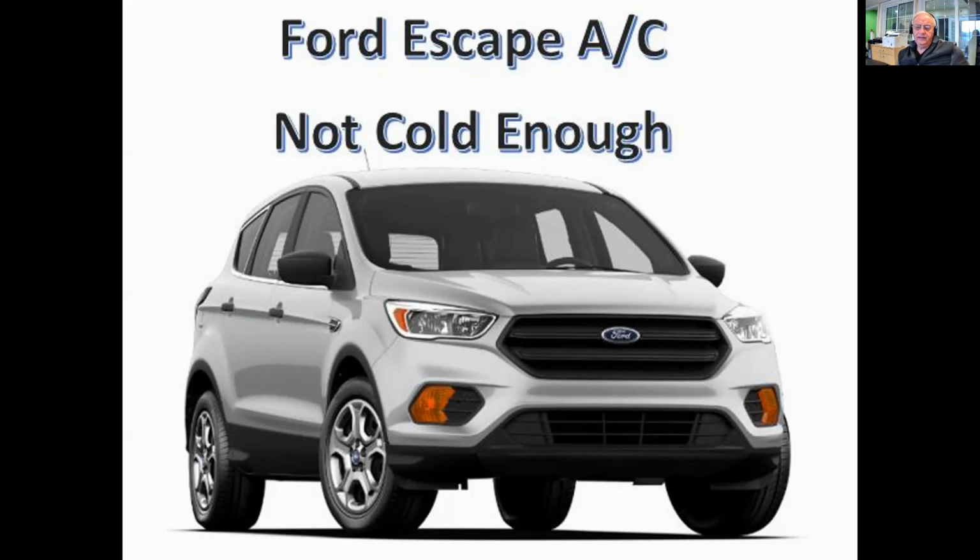Anyway, we got there to take a look at the car, and we went in, did the usual stuff, turned the air conditioner on to max, that sort of thing. And when we looked down at the clutch, the electric clutch, the clutch was actually turning. So the next thing we did was we threw a set of pressure gauges on it, and I'll show you the pressure gauges here in a second.